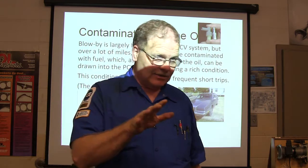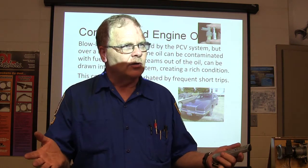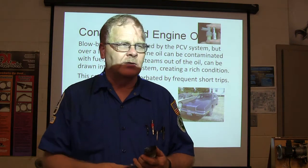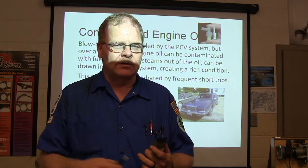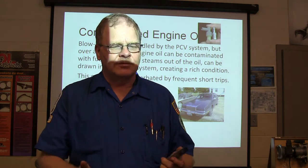All right, now pay attention. This story is important. It flashed the light, and it threw a code. I think it was a 17. Engine's running too cold. Got it? And I says, well, it needs a thermostat put in it. It's like a P0128 or P0125 on today's cars. He said, well, I can put a thermostat in it. You know, he had a shop over there that he had retired from and closed up. So he pulled it in there, jacked it up, changed the oil.